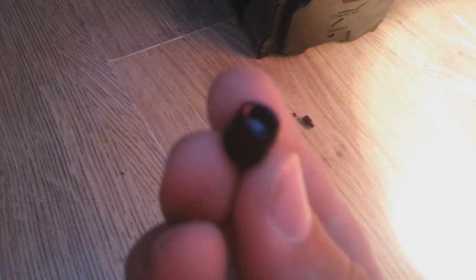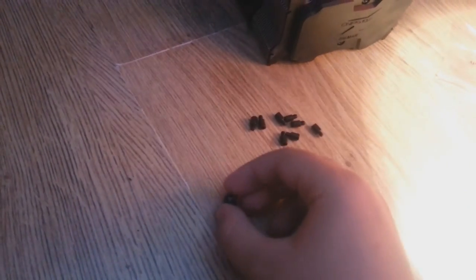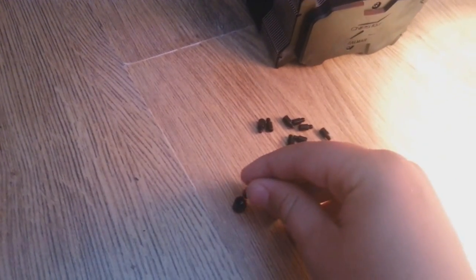I'm going to show you how to install motherboard standoffs. This here is your motherboard standoff. And this here you should get included as a standoff tool. What that does is you put your screwdriver into it, and say that's on your motherboard — you slide it over the top, and that allows you to screw it in.